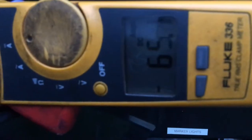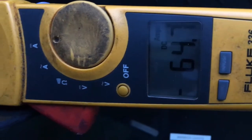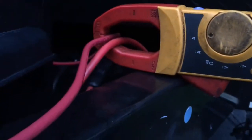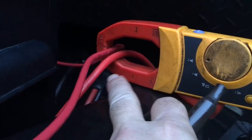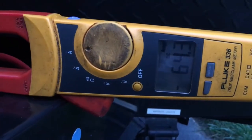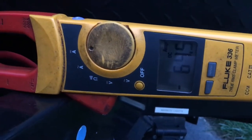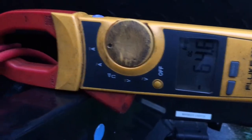We're at 30 minutes — 64 to 65 amps, that's crazy. This line I changed from a 30-amp breaker — because it would trip — to a 40-amp breaker, and it's holding pretty good. It's almost at 14.4 volts. It reads 13.5 at the batteries. That was fast.